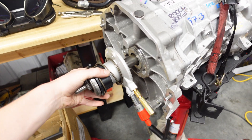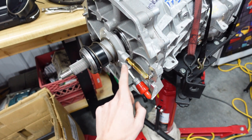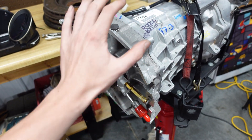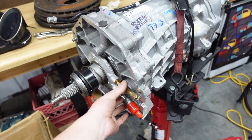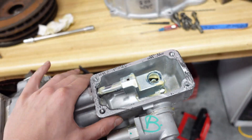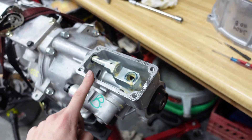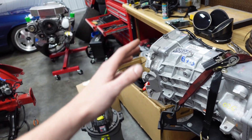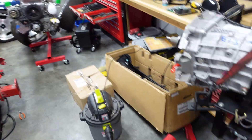Except for one thing - I was getting the trans ready to attach it to the motor and I realized I don't have the fitting that takes this quick disconnect to an AN fitting. So we're going to have to order this fitting. Unfortunately, the engine and trans are not going in this weekend - you're going to have to wait until the next video. But we are going to be installing a new fitting on here. I did just throw the GTO style shifter cup in while I had some free time, and we're going to get this shifter on here soon.